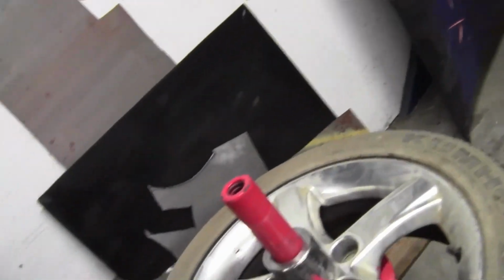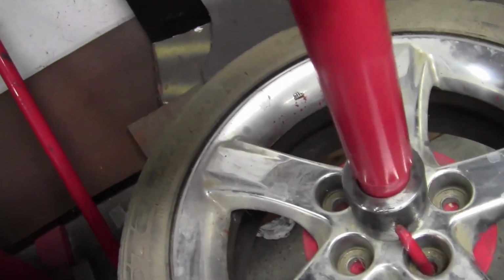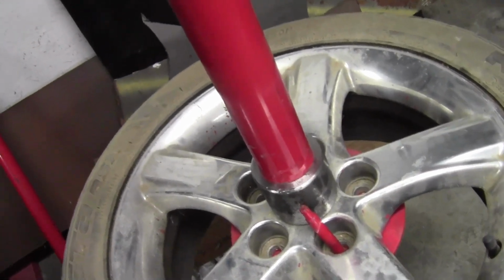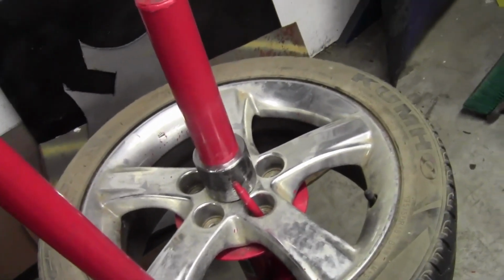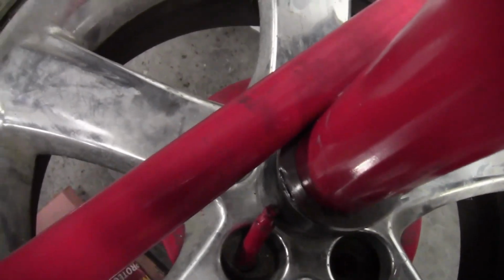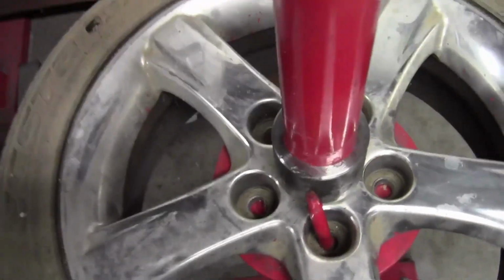And okay, here's the top right here on the floor. And it will tighten down. That's probably 3 inches. And the cool thing that Glenn and I found, and I'm not going to break this down, guys. Y'all have seen me break down tires before. The cool thing I found about this was when you stick the spoon underneath the tire and get it up over the lip, you can rest it right on the face of the cone while you're trying to pull around and break the bead off.